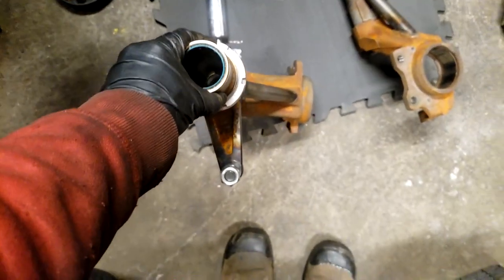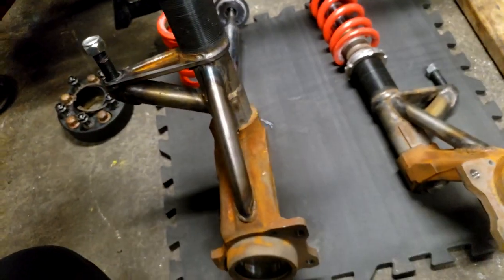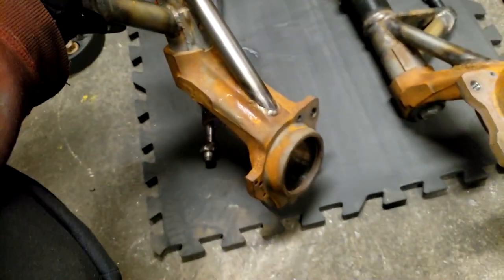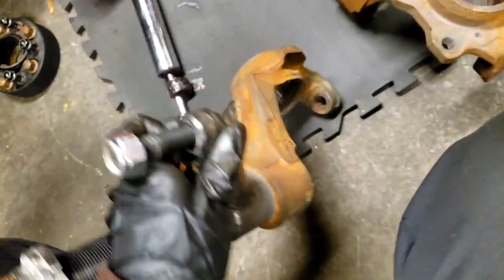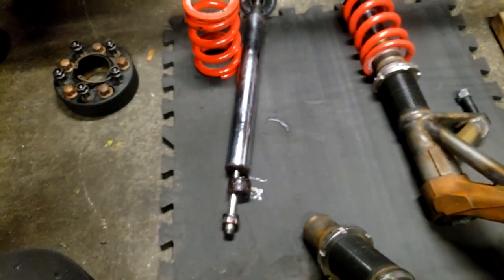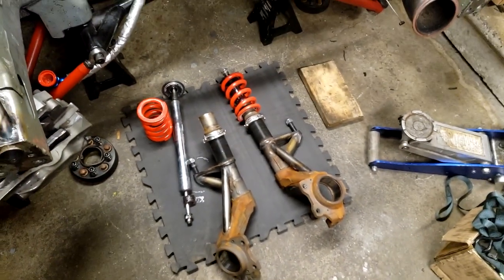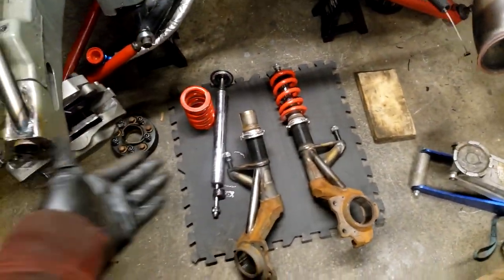A little bit of a secret is this car has anti-Ackerman, if you could see the angle of the steering arm there. You can only really do that on a Saab, I guess, with this setup, because you have to weld the arm on somehow. But it's a pretty basic knuckle setup. Again, you can see the hole at the bottom where the actual shock is retained. It's nothing crazy, but I don't think anyone's really ever done it this way. This is what it takes to get these cars to drive straight with big tires. They don't even want to drive straight without big tires anyway on 15s.